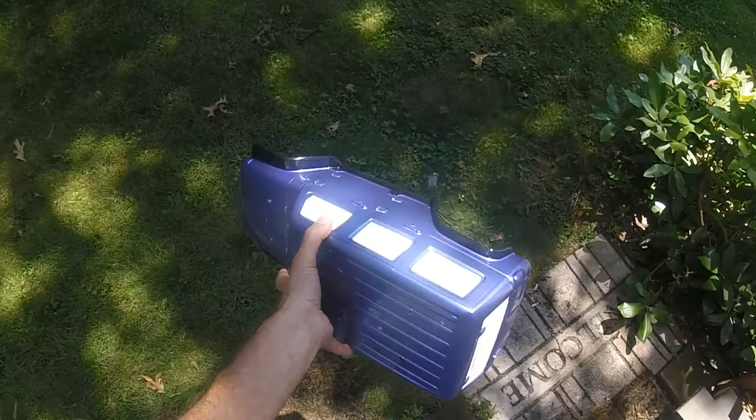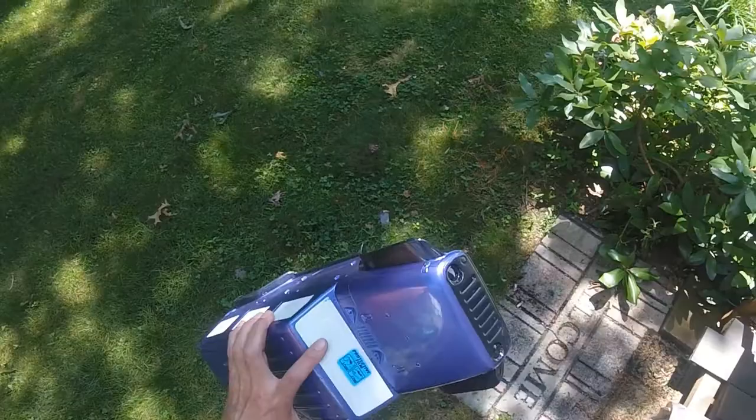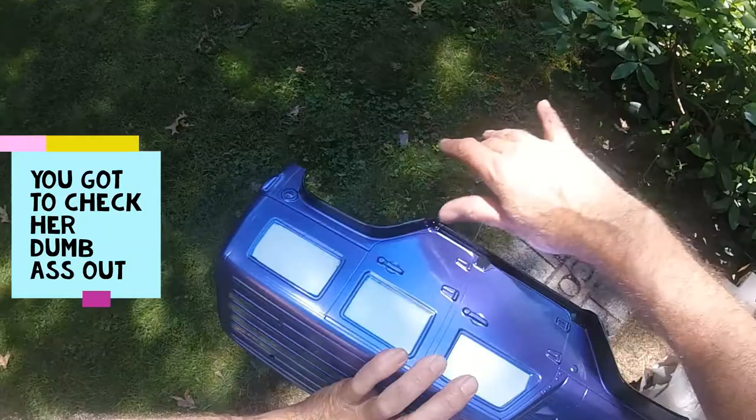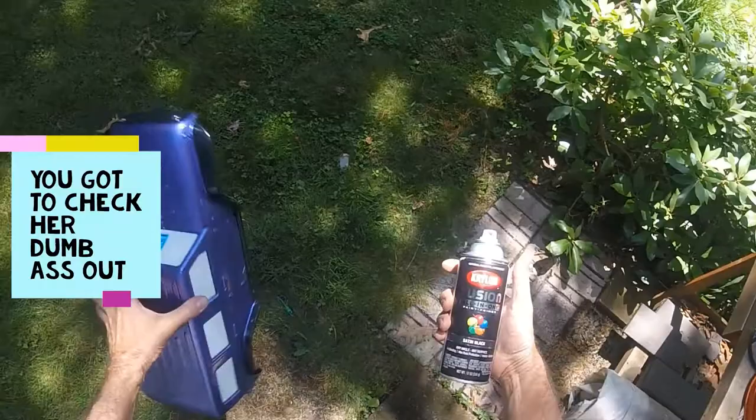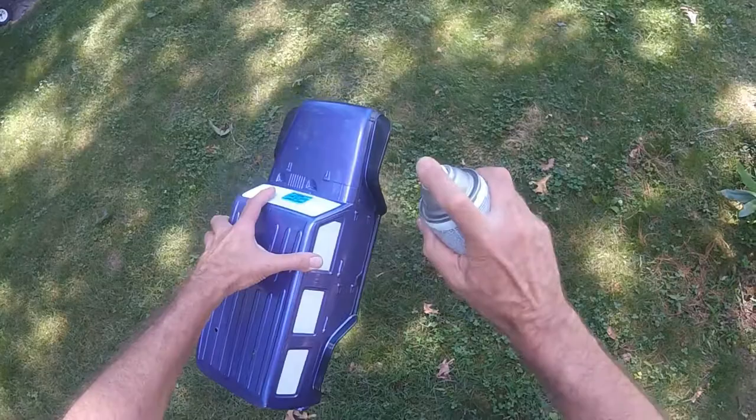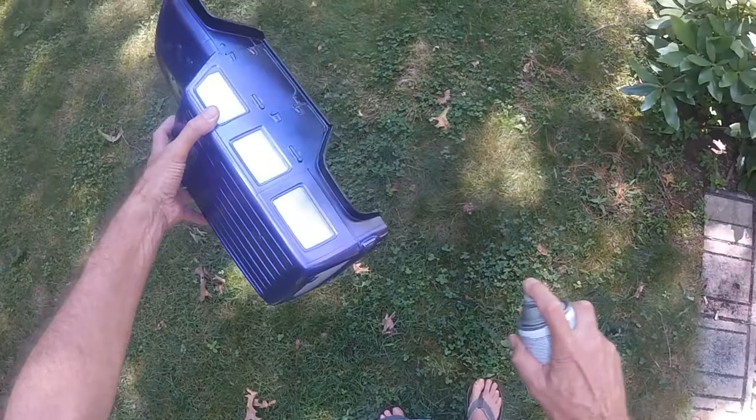Protective film's been removed off the areas I want to paint black, I hit it with the 3M pad, cleaned up all the hairs and lint and everything else. Don't forget — you don't want it to look like Jaclyn Hill makeup, you want your stuff to look nice. So let's spray this — Krylon Fusion All-in-One, black label, satin black. Keep your distance, put a dust coat on, make sure you shake the can up good. The further away you are the better off you're going to be, because you don't want it to look shiny — you want it to look plasticky.